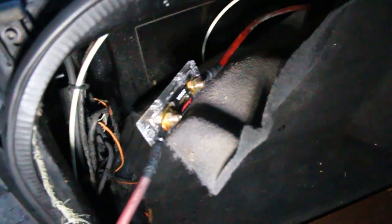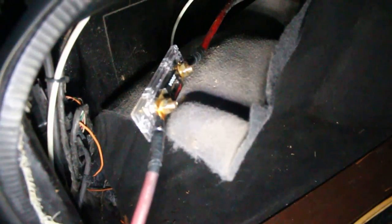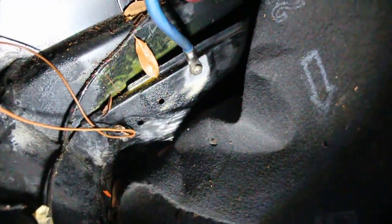We have our power coming through the side of the carpet there going to the battery, and right where you're standing is where the ground is going to go. Everything will be tucked behind the carpet and pretty hidden. Now we have our fuse in place — it's not a power trigger, it is indeed a fuse right here. You don't have to have one, but the point is if something happens with the battery it'll stop right there versus going all the way to the front. Our ground is now in place using an existing hole — we found one already there and a screw to fit, so that's where the ground goes.